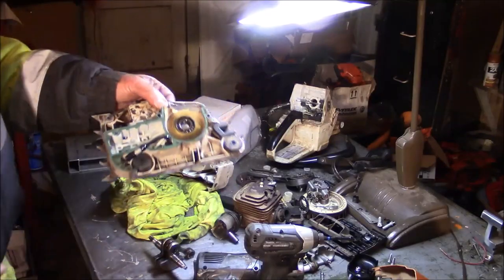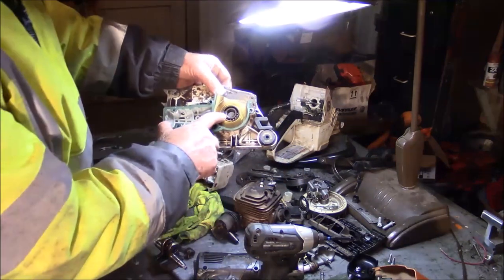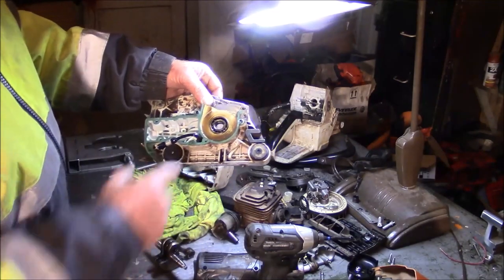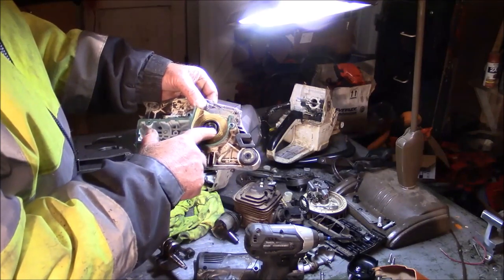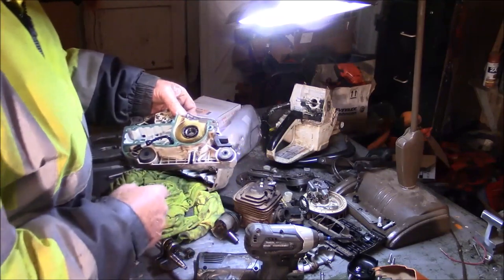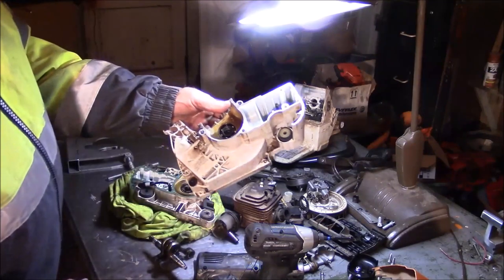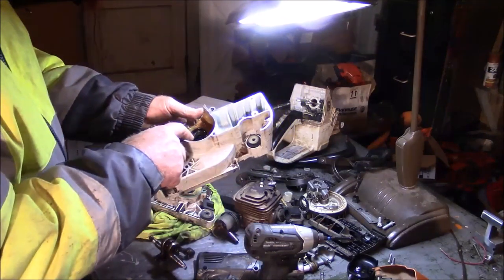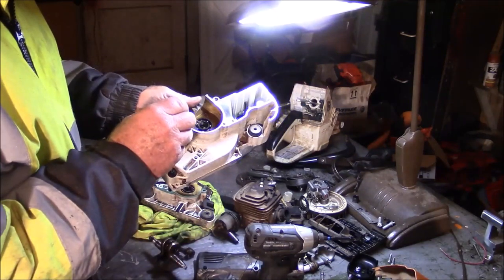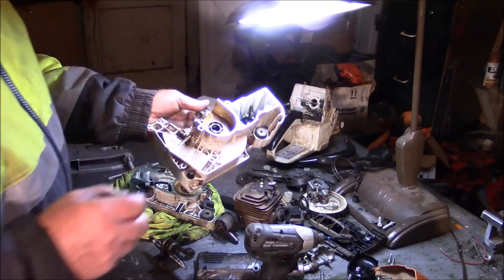What made the saw come to a stop is going to be very familiar to you. See all the balls have all run to one side there? Doesn't that kind of look like a 372 Husqvarna? Look at that thing wobbling there. Holy crow. And guess what? There's the flywheel side, and that's a nylon cage bearing. But not only is this a nylon cage bearing, but it has 1, 2, 3, 4, 5, 6, 7 balls.